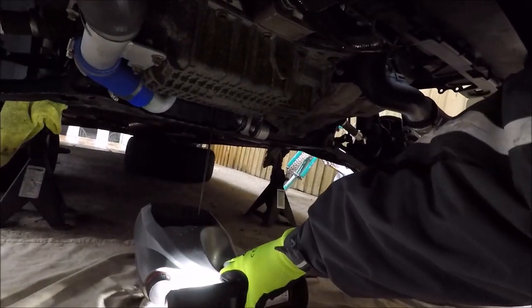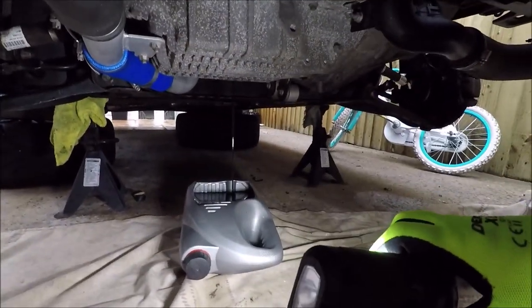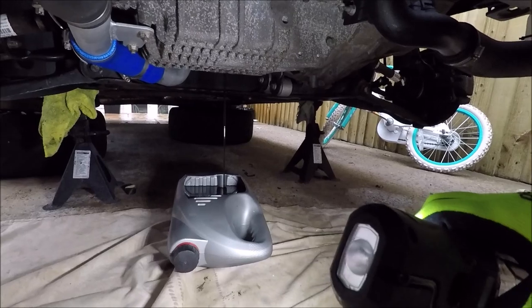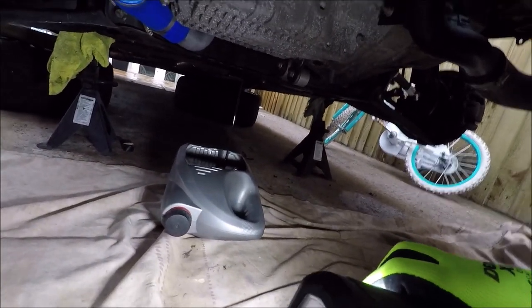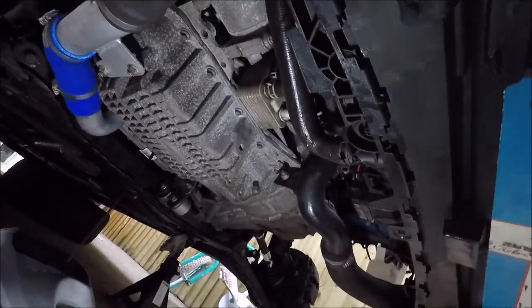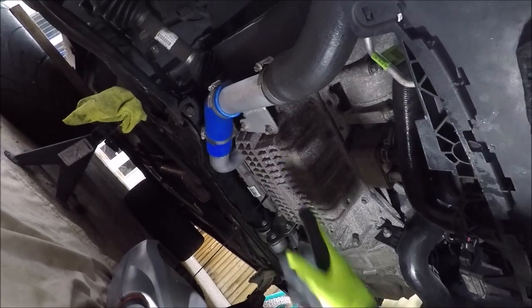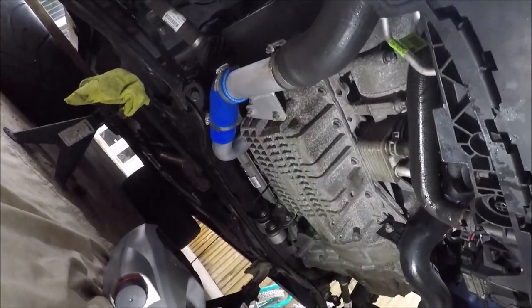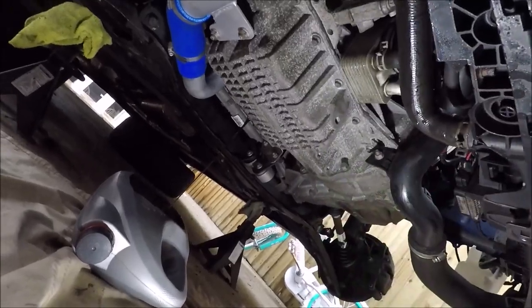So what I'm doing - I've got the oil draining now into a clean container because I'm going to reuse it. If you remember a few videos back I've done the oil and the car hasn't been driven since. So I'll be going back in and what we've got to do is disconnect the boost pipe here, remove the two bolts on that, take that pipe out of the way, and then we'll start taking the sump bolts out.